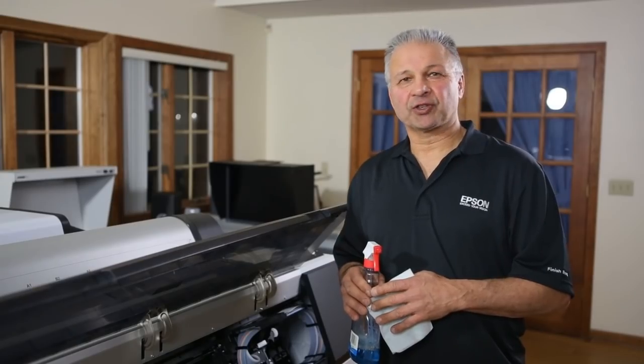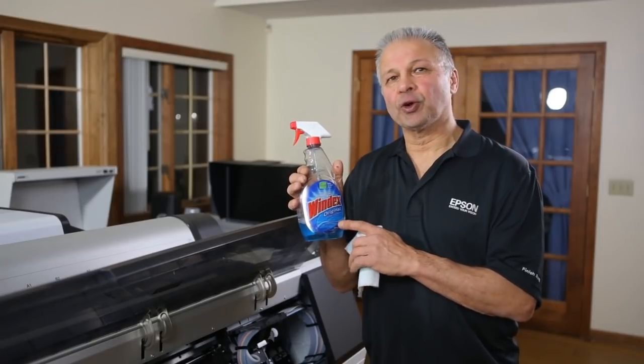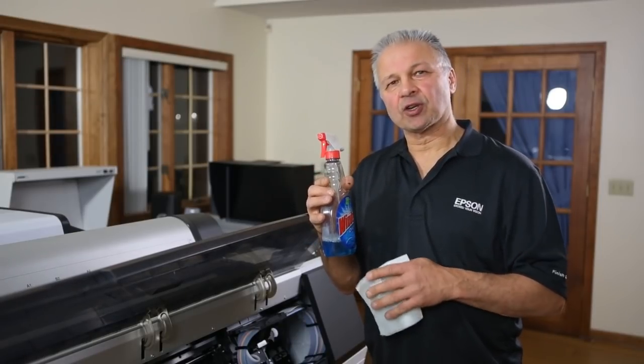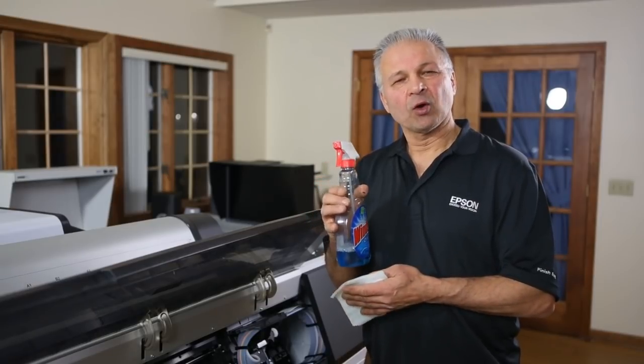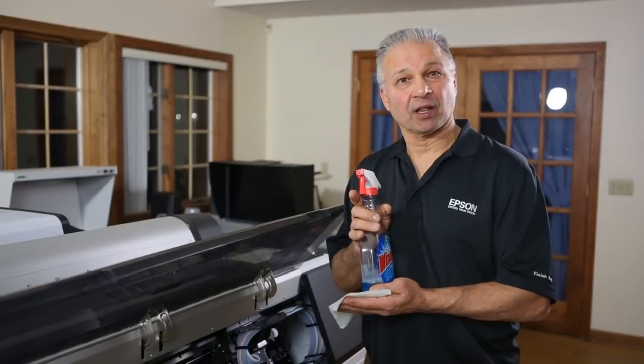So what you're going to need is some ordinary paper towel and some Windex. Make sure it's the original, not the foaming type. And why we use Windex is there's ammonia built inside it. What the ammonia does is the gases will dissipate your ink clogs.